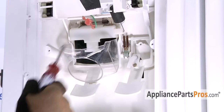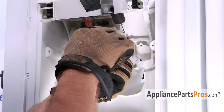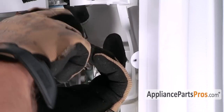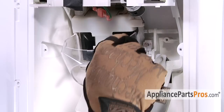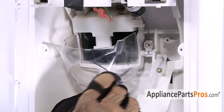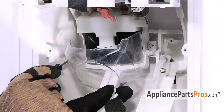To get to the part, we have to remove the ice lever. It's held in by a retaining screw that holds in this little spring clip — it's a quarter-inch screw. Go ahead and take it out, make sure you don't lose anything. Now that we have the screw out, we can lift up on the arm and pull it out of its resting spot, then pull the pin out of the left side of the door.